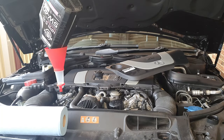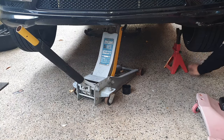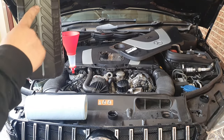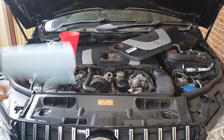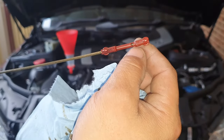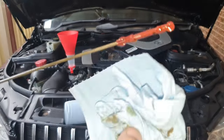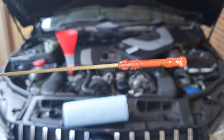That's five liters in. Now tip in another 500ml to a liter and see where the oil level sits. Remove the jack stands from both sides, lower the car fully, make sure nothing is underneath, and let it settle. Then tip in one more liter and check the dipstick. Looking at the dipstick, you have two markings — max and minimum. You only want the oil at the max mark, no higher. Reinsert and check — it's almost full. Another 500ml does the job, and now we are just on max. Perfect.